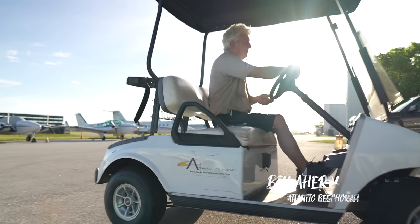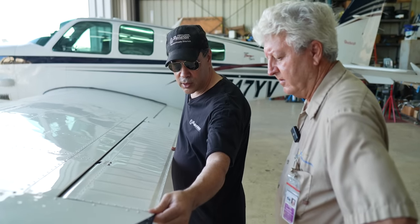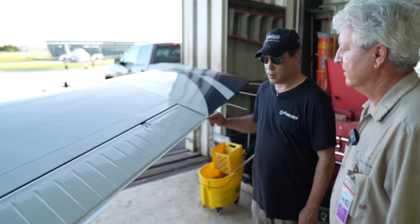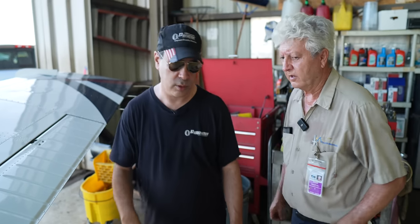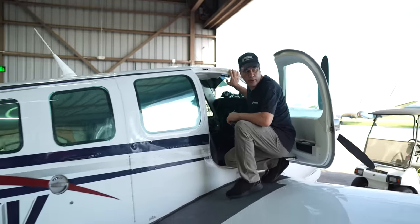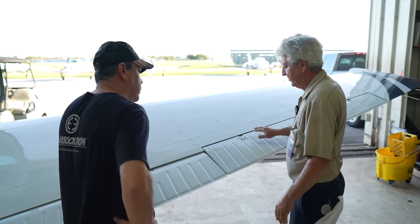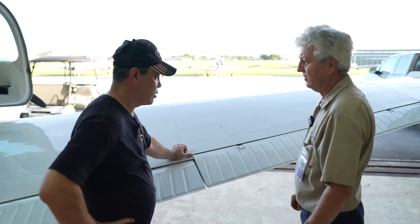When the yoke is straight, one aileron is down about that much and the other is up just a hair. With the yoke even, if the airplane is flying straight and level, you can see how far down one is. Most likely, if we straighten this out and even it up, the airplane is going to fly to the right, so we might have to compensate by lowering the flap.